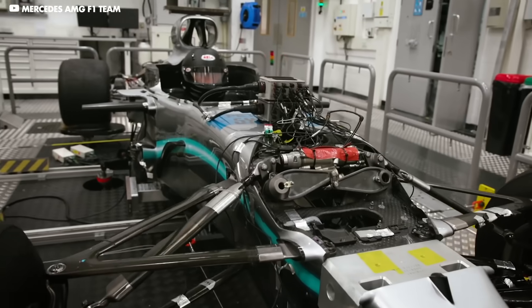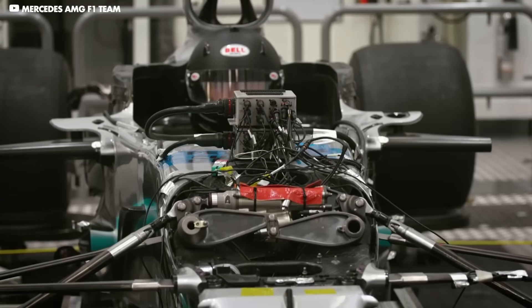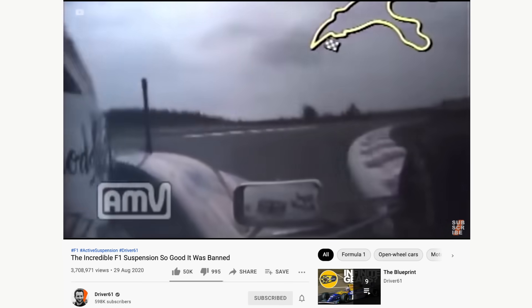When the car goes over a bump, the spring compresses to absorb the bump on impact and then forces the tyre back to the ground after the bump. The dampers control these forces of compression and rebound, preventing the car from continuing to oscillate on its springs. Suspension therefore allows the wheels to move independently of the car's body and follow the contours of the track surface for maximum tyre contact and grip at all times. So how on earth can an F1 car with no suspension be faster?